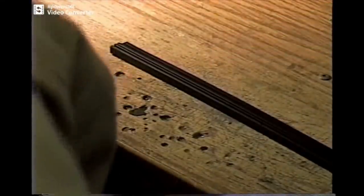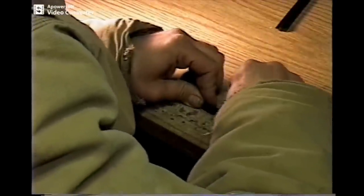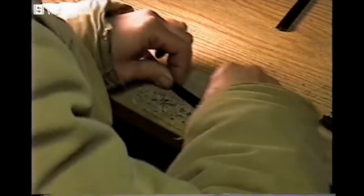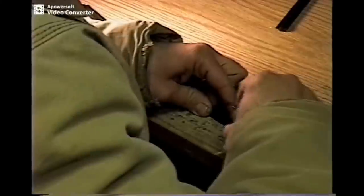Now what you want to do is get yourself your 43 180 wiper blade. Get yourself a nice sharp razor, because for some reason rubber tears razor blades up quick. So what we're going to do is trim where this first mark is at. So let's trim it all the way down. Mark. Try not to goof up and over trim. I just did. And cut the outside of the blade.